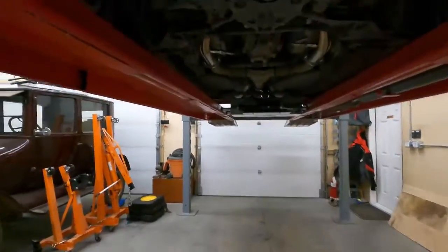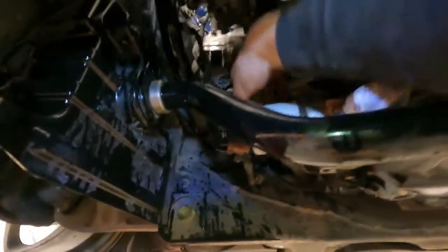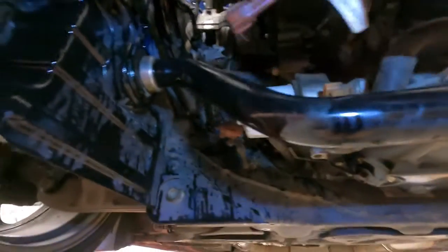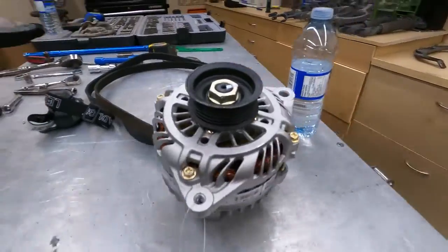For context, here's a rough breakdown. Two 8mm bolts on the back side of the alternator go through a bracket — take those out. Then there's a 14mm up top going into the alternator, and a bracket down below in an S-shape — two 12mm bolts. Pull all that out, then get the battery lead that leaves the alternator and charges the battery — that's a 12mm on the back side. Once you get that undone, undo the clips on the S-bracket, and then pop out the alternator signal control connector. Then the fan shroud comes out — big mess, just like I made — pull that out, and the alternator comes out.